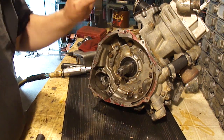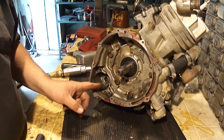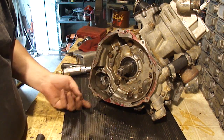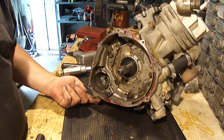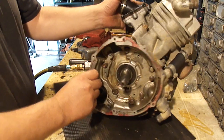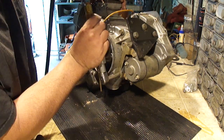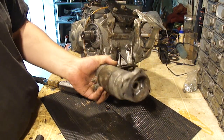I'm going to take the starter out now. If you power wash this or submerge it in water, this doesn't seal up the greatest and the starter is the lowest point, so any water gets in here goes directly into the starter. Anytime you suspect water in here, you want to drain it — there's a 10 millimeter bolt right here on the bottom of the motor that will drain the inside. On the backside of the motor there are two bolts holding the bracket that holds the starter on. Looks like I'm missing one.